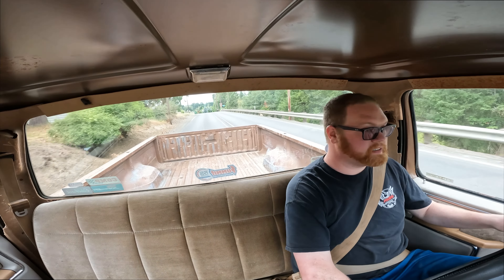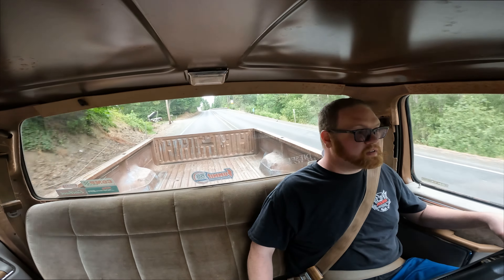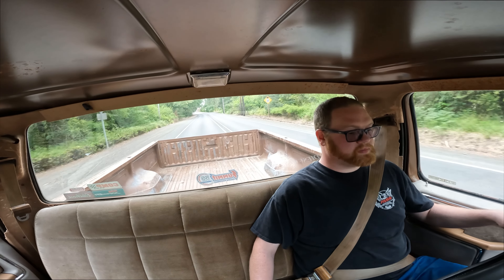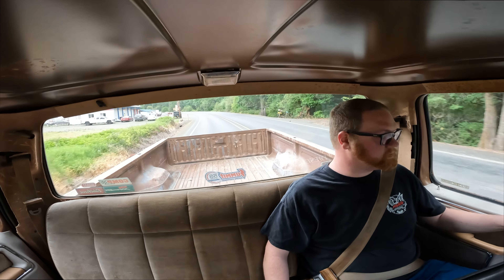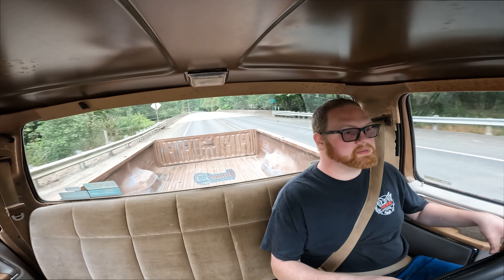Put the AC on — we got a full tank of gas. Wallet, phone, some keys. Oh, the AC's kicking in! Let's go for a little cruise, hopefully we don't break down. One cooling fan is on, which is fine — I want to keep the heat moving. Running 13.5 to 14 on the AFR. Running 55 miles an hour, 1800 RPM, 196 on the coolant. Right on.